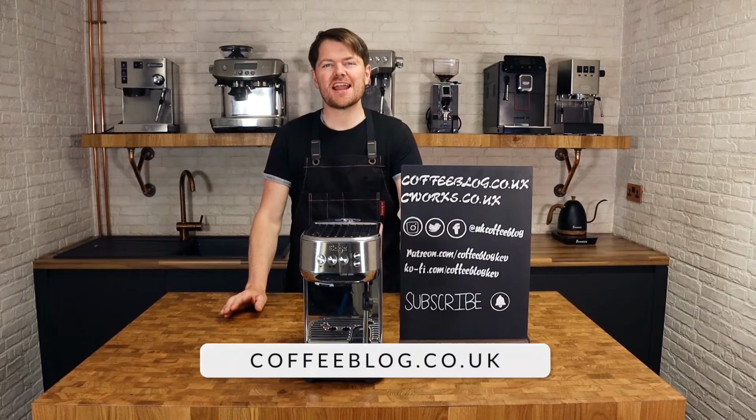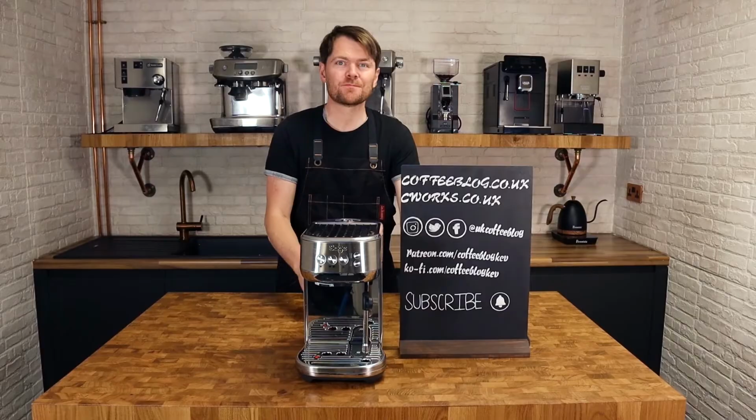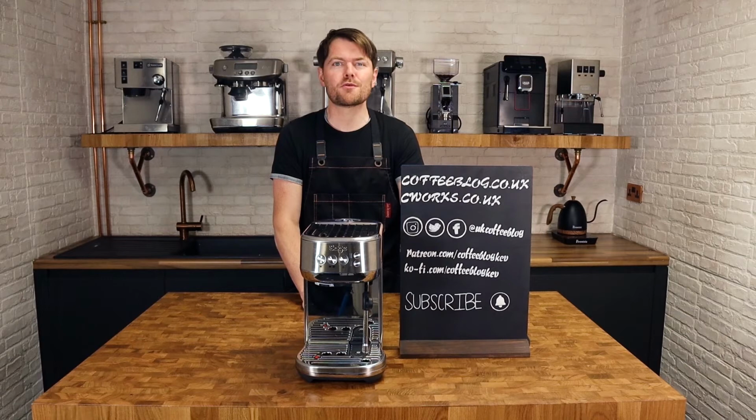In this short video, I'm going to be talking about entering the cleaning cycle on the Sage Bambino Plus when it prompts you to. The Sage or Breville Bambino Plus will prompt you to run a cleaning cycle approximately every 200 shots. And by cleaning cycle, this means a backflush cycle. Backflushing is when shots are pulled using a blind disc. So instead of the water going through the portafilter, it backflushes through the group and flushes out the solenoid valve.